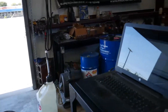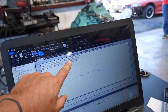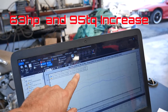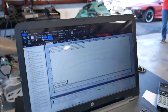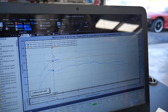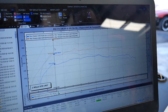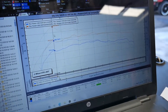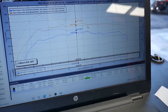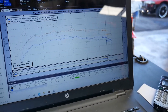The runs I have pulled up here are the best run on pump gas — which was 203 horsepower and 244 foot-pounds of torque — and then our best run on ethanol, which was 266 horsepower and 339 foot-pounds of torque. You can see substantial gains over the entire pull. Right here where the Subaru is making peak torque at around 3,700 RPM, you're dealing with almost 80 foot-pounds difference, and you're seeing horsepower gains all the way across to redline.